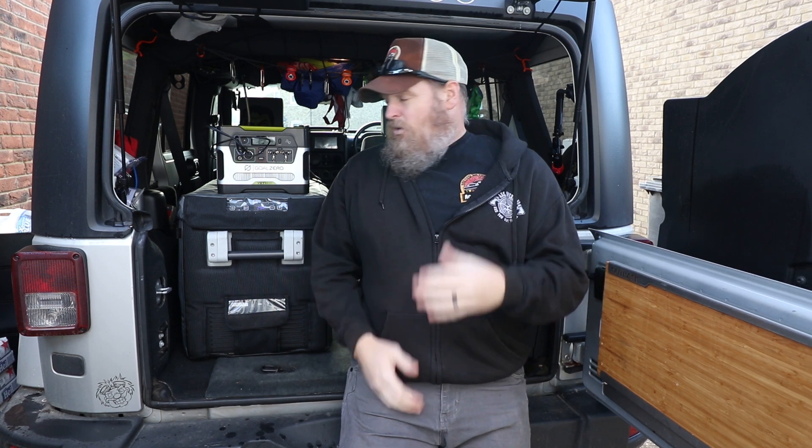Now solar — the reason it's so subjective is that in England we don't get a lot of sun. Even taking it to Belgium, it wasn't pulling in a lot of voltage, and I've abused the flexible solar panel: thrown it in and out of the back a hundred times and it's creased. I think I've flexed it too much and it's just not a great panel anymore. It pulls in between 5 to 20 watts regularly if you've got any sun, and that helps — but a proper hard solar panel that you can aim at the sun would do a lot better.